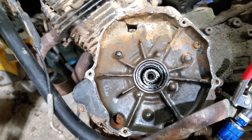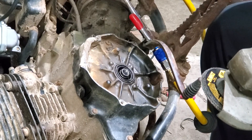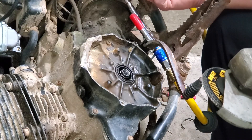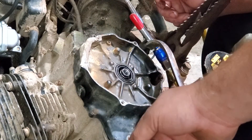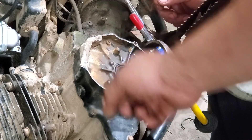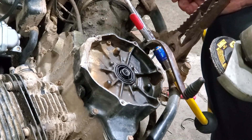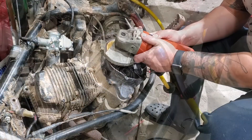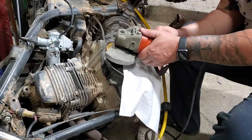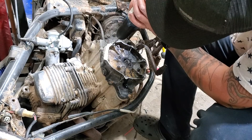I'm going to try and grind this down. Apparently this case was repaired at one point - I think it's JB weld. The side cover - at one point they broke something up here. The rest of the holes for the pull start seem okay. We'll have to tap them and make sure everything's good, but we've got to shave this down so everything will line up smooth. We're going to engage time lapse mode. Someone noted the easiest way to use a tap - put it in a drill - though I feel like that's sketchy.